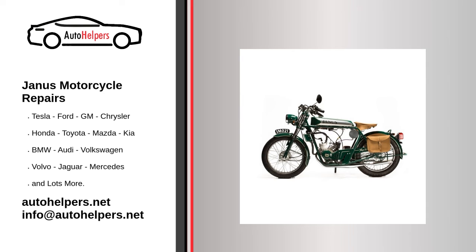This is especially common if the bike has been in storage for a while, or if it's been outdoors. Rodents looking for an accessible home might move into your muffler. But it's also possible there's just a ton of debris in there if the bike has sat for a while. Clear it out carefully and see if that helps get the bike started.